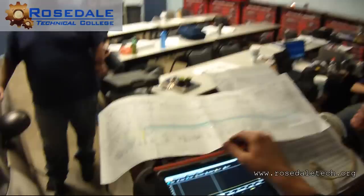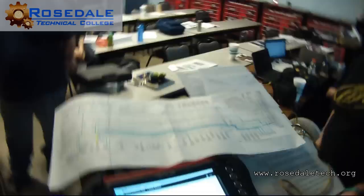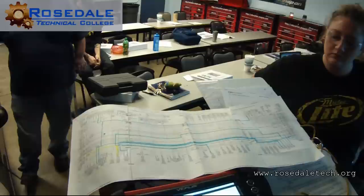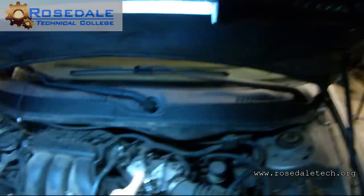If you guys have some time, you could get another waveform for some practice. Go to your home tab, then guided components. This is going to be on this car, U.S. domestic. Then let's go fuel injection and pick something easy. Let's go TPS, the throttle position sensor. We want DC voltage. Follow your prompts; it shows you how to hook up the meter and what it should look like. To get that waveform, the car is off, the key is on, and all you're going to do is open the throttle and let it go, and that'll give you that kind of waveform. Snapshot that picture, that'll be one of the ones I want you guys to have.